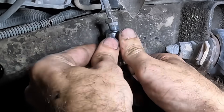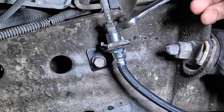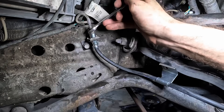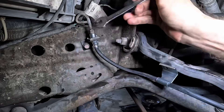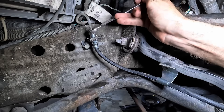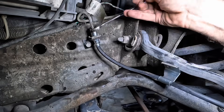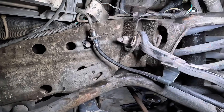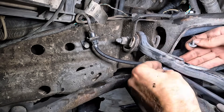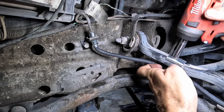Let's put that in so it stays — now the line can't come out of its bracket. We can get this guy threaded on and in position here. A few turns on this fitting, and that'll lock down the hard line. We can go get that banjo bolt on and get the caliper connected. I had to take the bracket off to get some fitment action going, so let's get this thing back in position here. Wrap it around, get the bolt in. Re-click, very good.